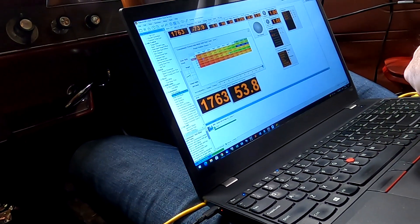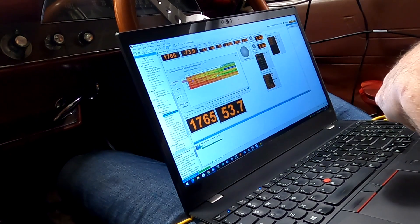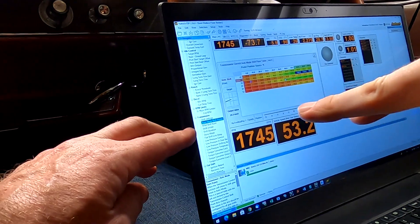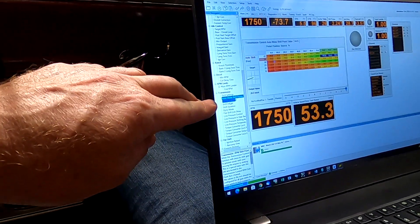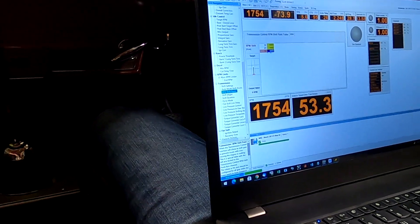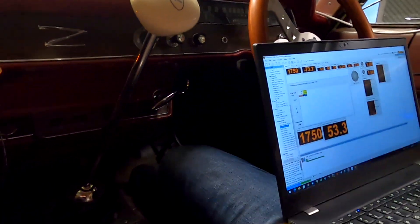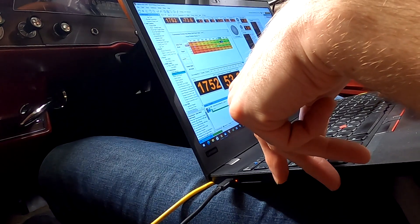Third to fourth - we were wondering about over the line, we want it to go to like 190, not change. But you still want to shift before the limiter. It's got a shift inhibit anyway. That RPM shift point is at 6400 - it says it's going to go at 6400, so that's to choose a gear to prevent over-revving. Top gear is like 180km/h, it goes to 200 at 6500. So we can probably go up to 180.